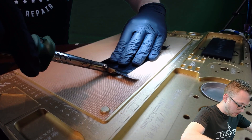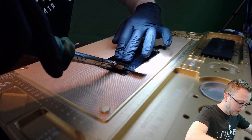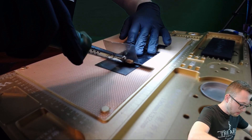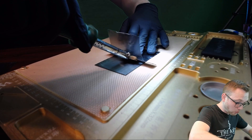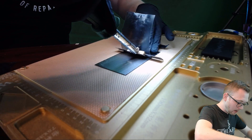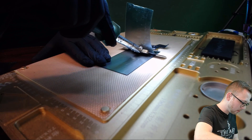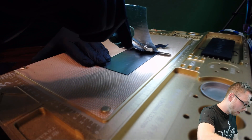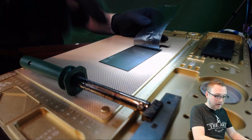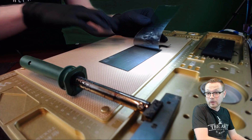Now that we have it on there, I'm just going to put a little bit of pressure in front of it. You don't need a lot — there's a hot blade in there and it's going to eat up the glue. I'm pushing down on the display, rocking back and forth a little bit, and you can see this is coming up with ease. No problem. Just rock it back and forth. Try not to let the bottom metal piece of the jig itself scratch the display, so you're going to have it up at a little bit of an angle. Once we get close to the edge, I come around and grab the back. Now here's the key: you want to stop maybe two or three millimeters from the end. Why? Because that blade is not only sharp, but it's hot. We don't want to get up into the flex area — if you get up into the flex area, you could damage the entire thing and it's game over.